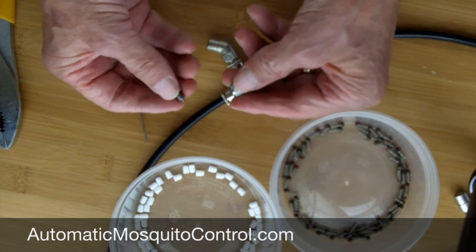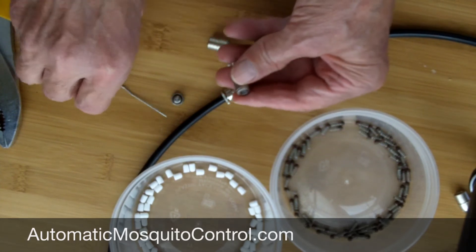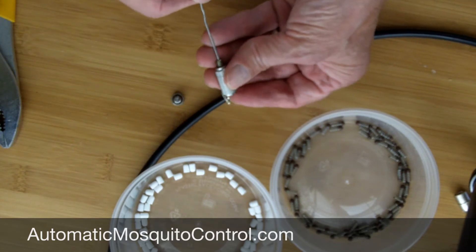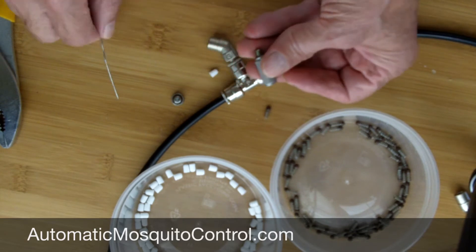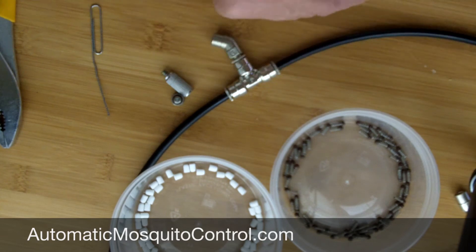If you're not careful, it will go all over the room. Anyway, you just put that off to the side. Take a paper clip or something and you put it through the inlet side and push the old spring ball and the old filter out. And you throw that away.